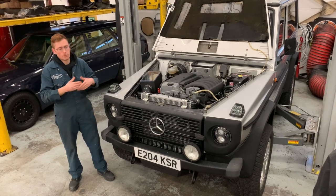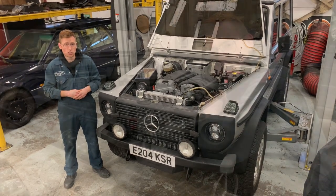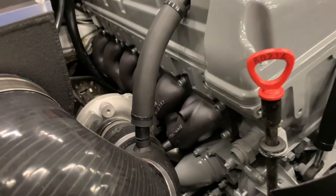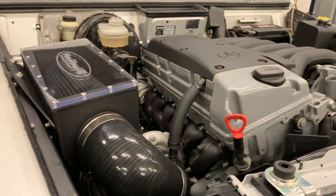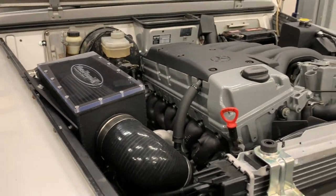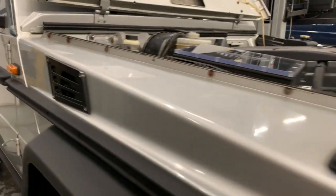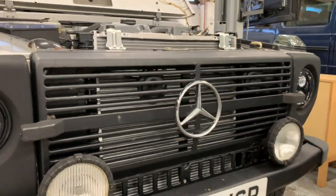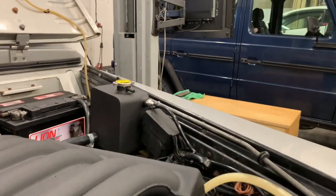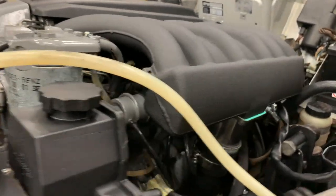So these kits are 300 horsepower. When you come up against that, you're going to start to encounter these issues. Some of these cooling modifications include ceramic-coated manifold and turbocharger, fully sealed cold air intake system, aesthetically pleasing CNC alloy wing intake, W463 aluminium radiator conversion, block cooling modifications, header tank installation, integrated oil cooler system, and fully armoured low mount intercooler.